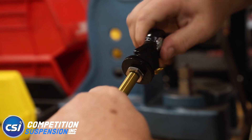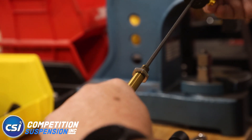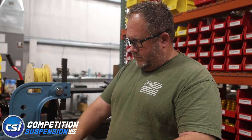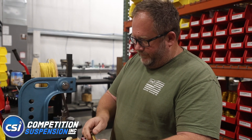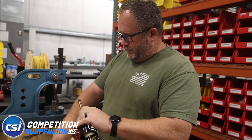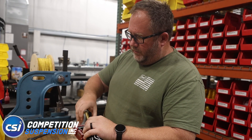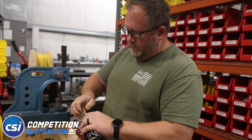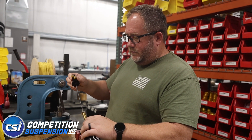When you screw this out, the metering rods stay connected to the rod end, so be careful to just pull them straight out. From there, everything else is the same: put your bump rubber on, put your cup on, and make sure to get the jam nut all the way back up the shaft.